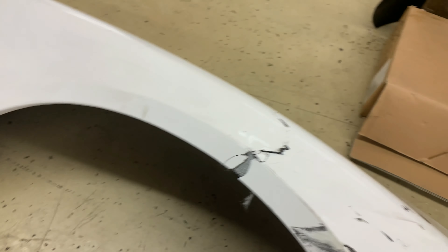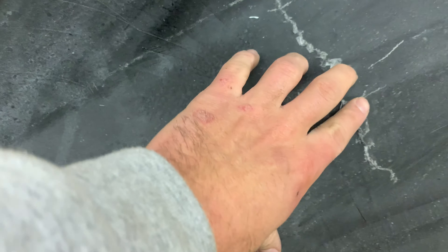So this one's got a little crack in it — it's the right front fender. It's obviously got this bust in it here as well. That's nothing a little aluminum won't fix. We'll put a little aluminum piece right here, also make one that fits right here, and then just countersink on the top a couple of inch rivets and let her eat. It might not look the greatest, but throw a little piece of white decal paper over it and you won't even be able to tell hardly. This fender has the same issues — just got a little bust up here. Probably need to put a little piece of aluminum behind it and white decal paper over it. I always say my cars are fifteen-footers — because if you stand fifteen feet or more away from it, they look beautiful. But if you get any closer, you're going to see a few blemishes — but that's part of it.